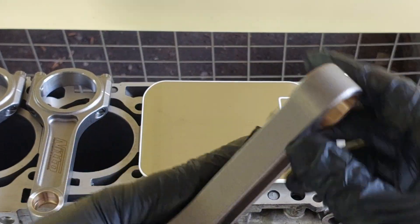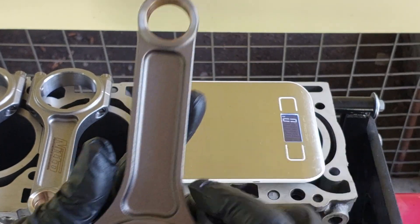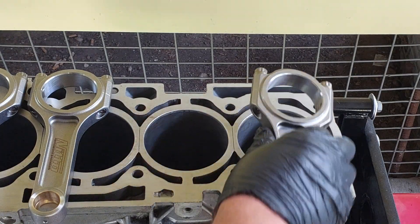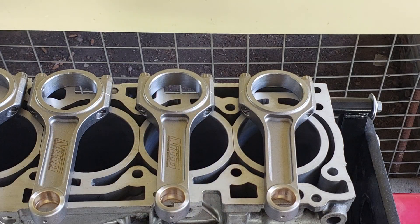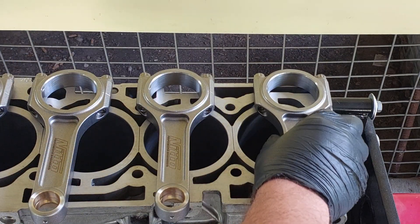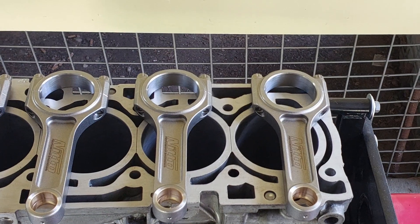Keep in mind you have your reciprocating mass which you want to balance — you want to balance this end, not that end. You don't really want to take off from there because you'll weaken the rod. But that's basically engine balancing in a nutshell for this one. Unfortunately I can't show you guys much of that because they don't need balancing — if it's not broken, don't fix it. Next video will probably be on the rods in more detail, the designs and everything. Thanks for watching guys, sorry a little bit of a disappointment on the balancing. Our parts are good so we're pretty much ready for throwing those in the engine. See you next time and until then, have a good time.